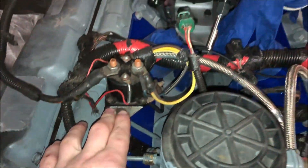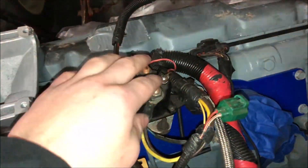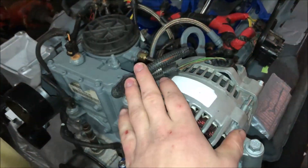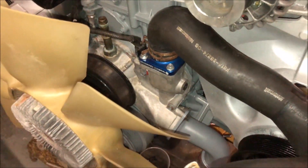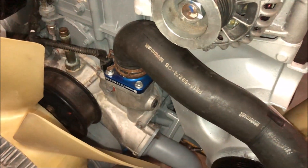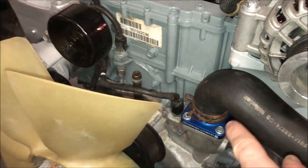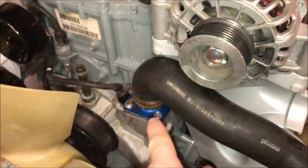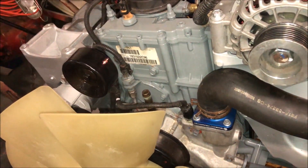This bolted on pretty nicely. It's cool because when you're swapping just your harnesses, this all comes together — you don't even have to touch these; just take it off the bracket and it'll come off with the harness. This alternator is off that engine — it's a year old, so it's fairly new. You can barely see that I've even cleaned it and it's this clean. Another thing I took off that engine is the water pump and fan. The water pump is also a year old — that's why I'm reusing this stuff. It also had this nice Sinister Diesel billet housing on it, which you need because the rusty ones leak all the time. I had a rusty one before that would not stop leaking — with the billet one, never had a problem again.